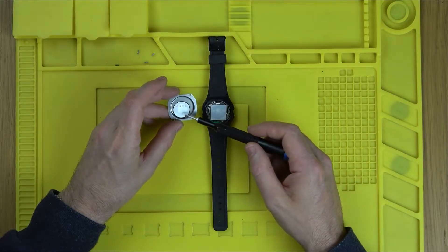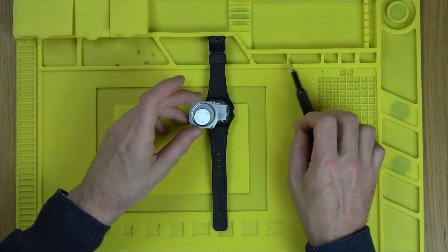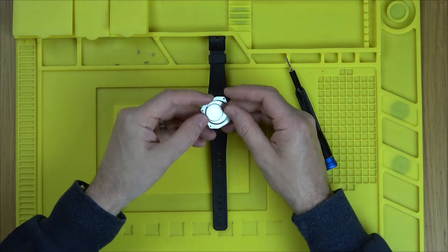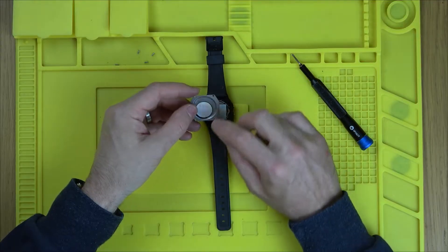This is the thing that makes the sounds — this is a little piezo buzzer here, and you can see the contact for it is just here. So this has to go on this way around. If you put that on upside down, the contact will hit here and it's not going to make a contact. It has to hit the buzzer.